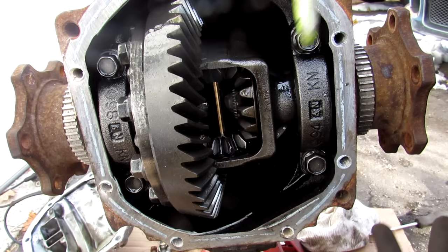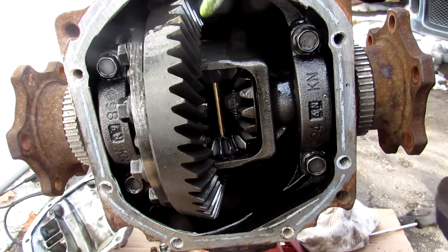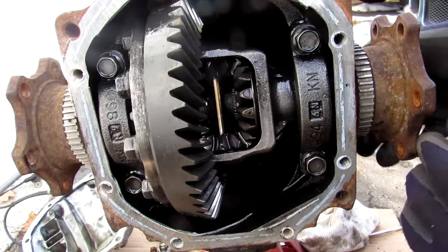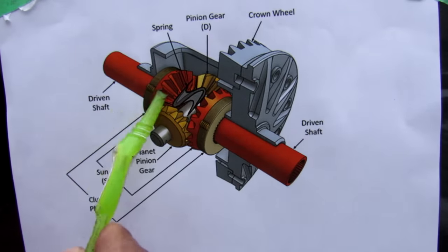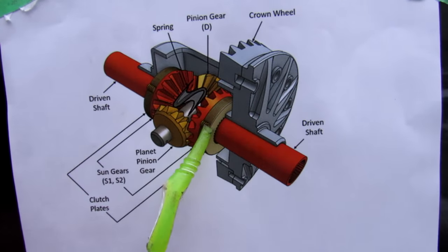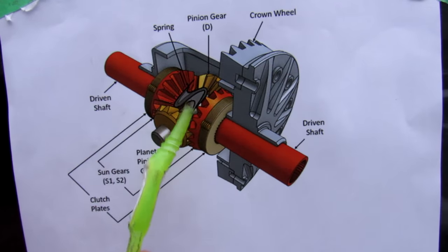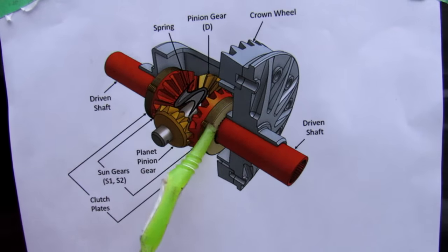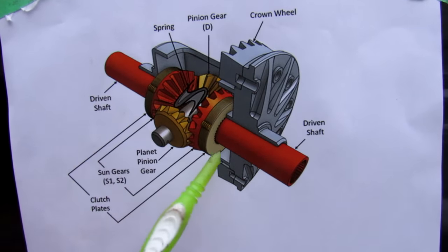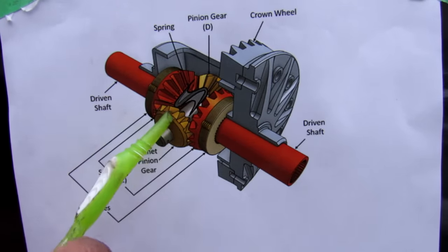Now there are a number of ways to overcome this disadvantage. The first is to use a limited slip differential, which has a series of clutches and viscous fluids to limit the difference in torque between the two wheels, but still allow a tiny bit of slip so you can take corners. A limited slip differential uses two clutches on the two side gears to separate the gears from the shafts that go out to the CV shaft. The clutches have tabs that lock into the differential casing as well as teeth that lock into the shaft itself. When driving straight, the spring puts pressure on these clutches and causes them to lock, essentially creating a locked solid axle. However, if there's a small difference in wheel speed such as taking a corner, it will easily overcome that spring pressure and allow a little bit of slip so you can take that turn.